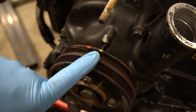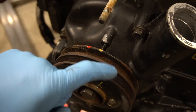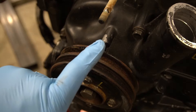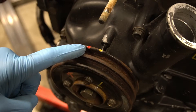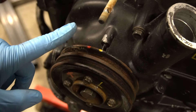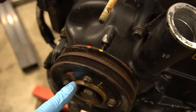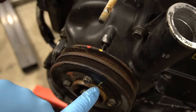From the factory, going clockwise on the right-hand side is your leading rotor one mark — that's indicated in yellow in the service manual. And the one to the left of it is your trailing one timing mark, indicated in red in the manual. You'll see on my front pulley I put T in red and L in yellow.